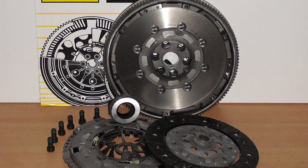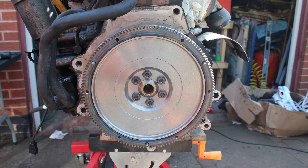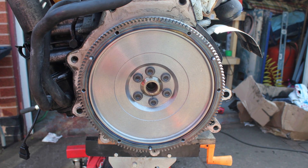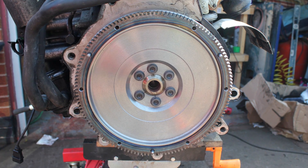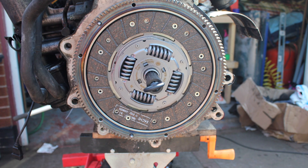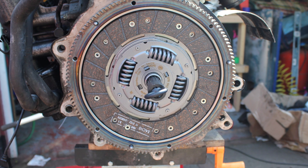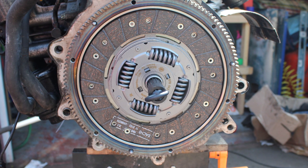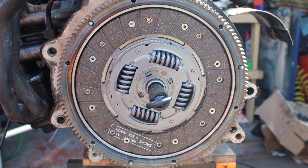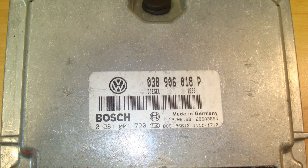The first thing I'd personally sort out is the clutch. You can run a stage one tune with mild power gains, but eventually the stock clutch on my type of TDI will start to slip. On my car I fitted a G60 flywheel — a single mass flywheel rather than a dual mass — along with a VR6 clutch. This combination is good for about 200 brake horsepower and around 300 foot-pound of torque, so I don't have to worry about the clutch slipping straight after putting a tune on.